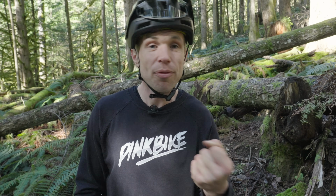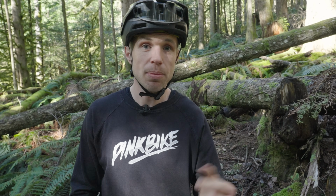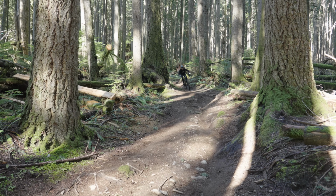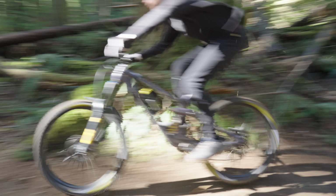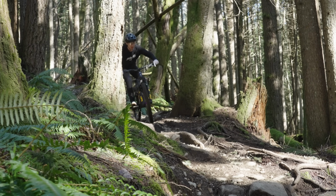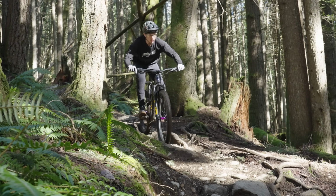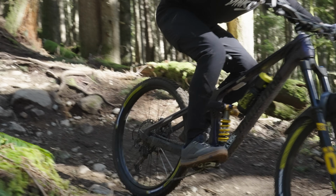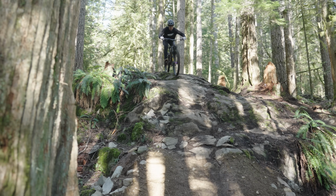performance essentially when going uphill because you don't have that immediate drive, meaning that slack can leave you searching for a gear as you ratchet up technical sections. It is a very personal preference though, and I think hub manufacturers acknowledge that as such by offering different amounts of engagement for their hubs to suit the rider's preference. Now, I would say, for my 2 cents, find an engagement level that you like and then try and find another solution for the issue of chain growth.